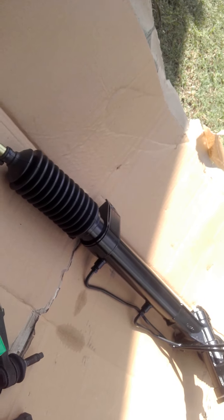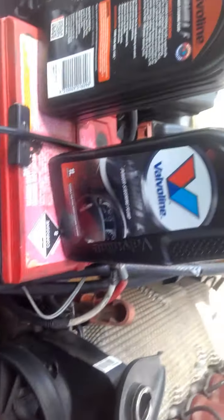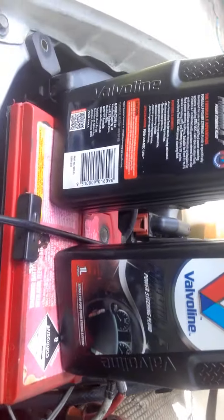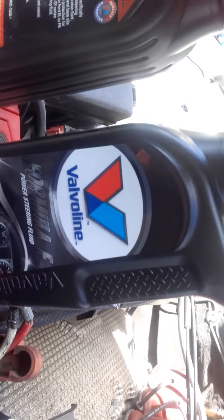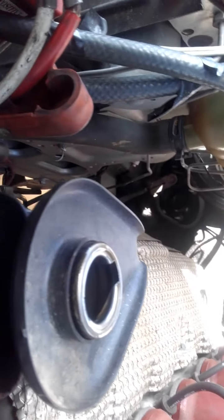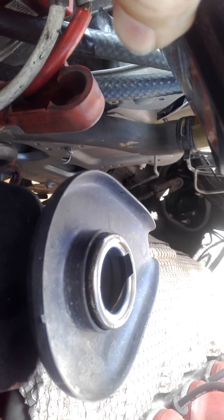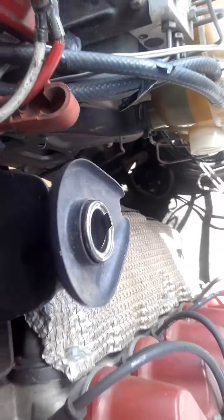First of all we're going to put some flushing fluid through the old lines. This is the oil I'm using — Valvoline. It says it's for Ford EF to FG, so we'll just put some flushing oil through to get rid of any of the old oil out of the lines. Watch that come out the bottom — coming out both lines, that's good.